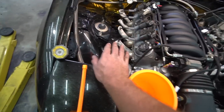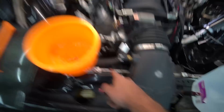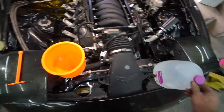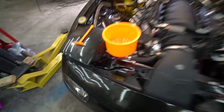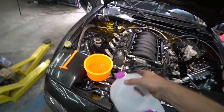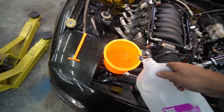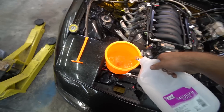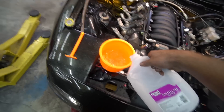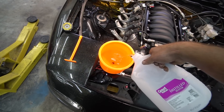We've got to fill out the cooling system now. To bleed our cooling system - before, I had an expansion tank which brought my fill point up above the highest point of the cooling system, because my radiator being tucked under the core support is lower than the highest point of the cooling system so you can't bleed all the air out. I built that expansion tank and blew it up going a little too hard at the Freedom Factory. So I don't have one right now and didn't really have time to build a new one. This honestly works pretty well - it's a funnel that goes on with a cap. If you fill it up, it's higher than the highest point of the cooling system and you can bleed it out properly. You can fill it up three-quarters of the way and just watch the bubbles come out. We fill it up until there's no more air coming out, then start it and watch it. Once all that's done, we put the cap back on - call it good.